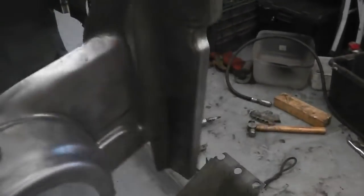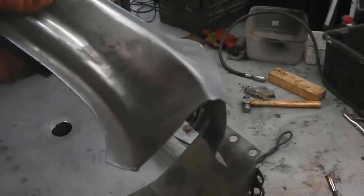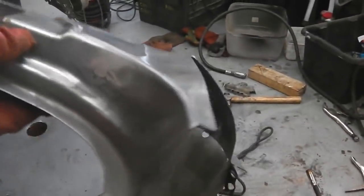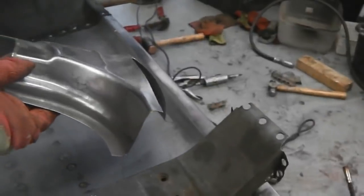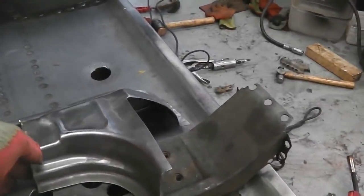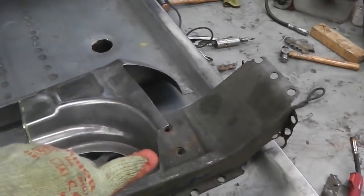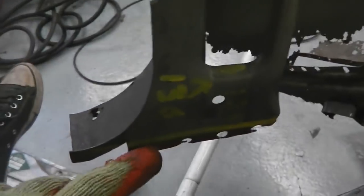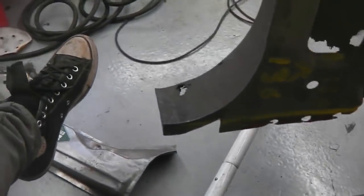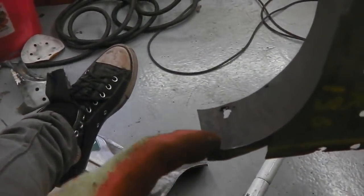bearing in mind it's a copy part, we want to make sure that it lands on the sill. You don't want to fix this and when you come to offer your sill up, the sill runs parallel, and you've got gaps or it's too tight a fit on this bottom of the ski jump. So they need to work in unison. If you were leaving this on, then it wouldn't matter, of course, because the reference point remains. But because now that reference point's lost, we need to make sure that we're happy the sill lands on the yellow lines and everything's in place, and then it's nicely tight up to this, which hasn't moved vertically. It may have moved laterally, not moved vertically, and indeed we've got our measurements for that distance anyway.